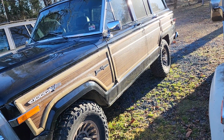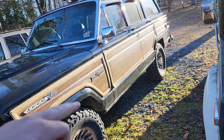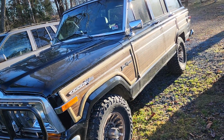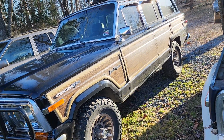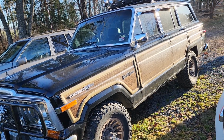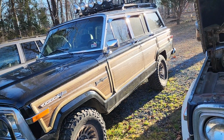But the lowest vents on these Jeeps are typically at the transmission hump, okay? So that's where you want to get your measurement from. The axles are fine. It's the transmission and transfer case you've got to find out how high they go. So measure your hump. That's how high you can go in water.